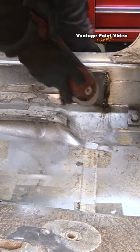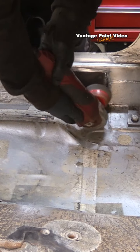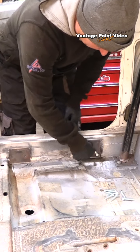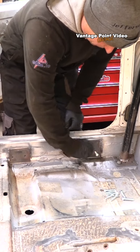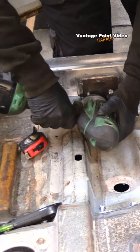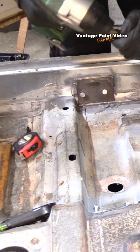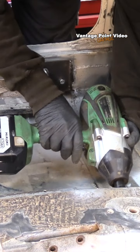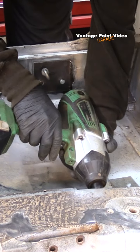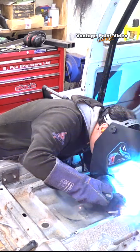Especially with wire wheeling coming up, there would be a good blast of wind sending metal swarf everywhere. I cleaned up the areas to be welded and used ordinary bolts to block the holes so I don't get welds in the threads. I only had some long ones, so I used the gun to carefully drive them in. I wanted to be confident of the captive nuts I'd welded on, especially the ones in the sill which I wouldn't be able to get at if they broke off.